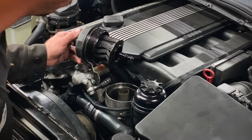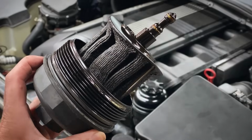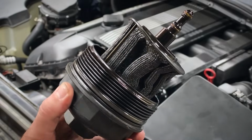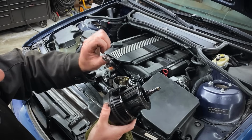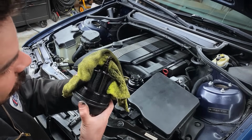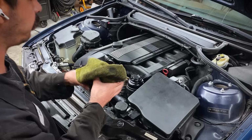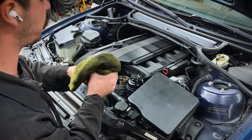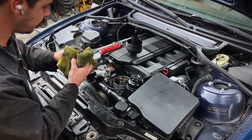Oh my God. I don't know what caused that. I did the oil service on this car myself. I think it was a cheap O'Reilly Auto Parts filter. There's so much sludge caked in there too. Like, look at that. That's just engine sludge. You know, this engine is not that healthy. It burns quite a bit of oil, about 1 quart every 1,000 miles. I'm pretty sure the valve seals or something in the top end is leaking. I've never seen so much sludge in an engine before.